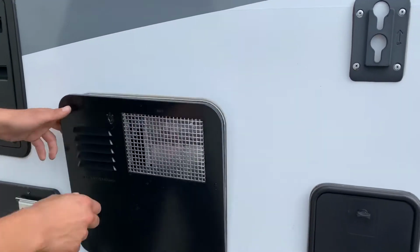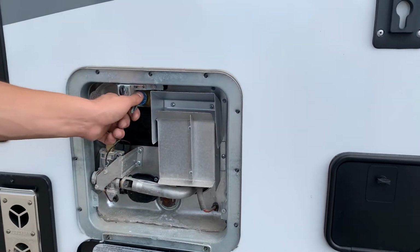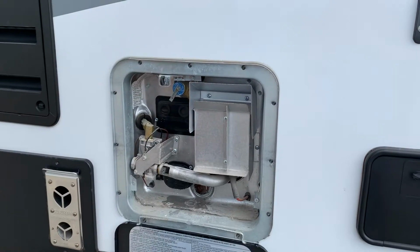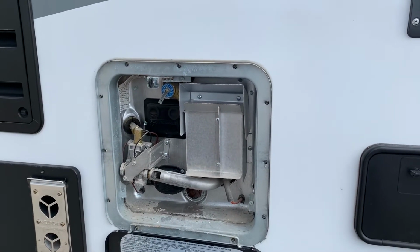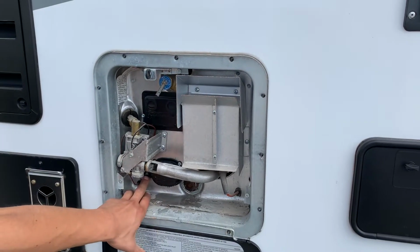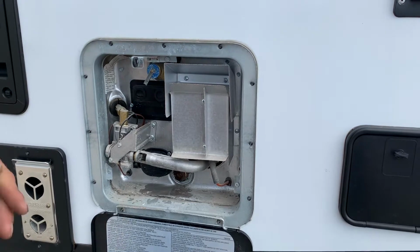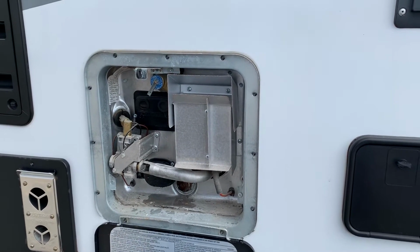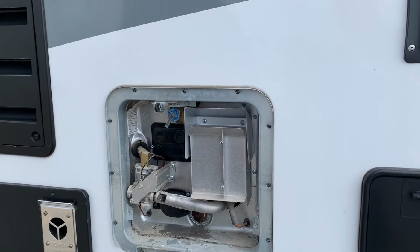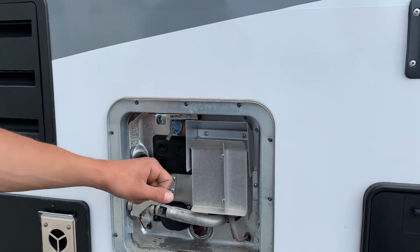And right here is just your hot water tank, so line up that two-way, pops open. Before you ever turn it on, you just want to hit this pressure relief valve, make sure that bit of water comes out. That bit of water coming out is just letting you know that it is full and safe to fire it up. We're firing it up with electricity, just down in the bottom left corner here is a switch. Turn that on, turns it on. And for running it with propane, the switch is just inside. Now I will explain a reset procedure once we get back inside. And the reset button is just right here on the right.